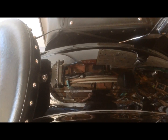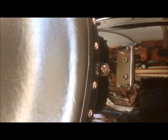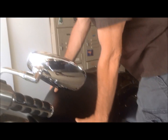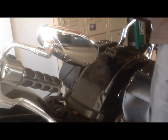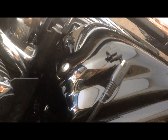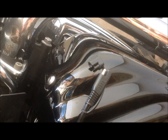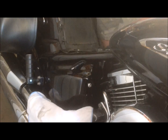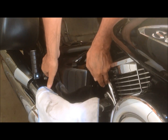The passenger seat gone, now you get access to the rider's seat, and that will require a 7mm hex wrench. Okay, to remove the rider's seat, simply pull up. We just took out the bolt and pull backwards. It's easy removal. So now's a good time to reach over and take off that right rear cover using a 7mm hex wrench. We'll be disconnecting the negative wire from the battery so we don't mess anything up while we're doing this. Okay, once you've unscrewed this bolt, you take this cover off just as if you would your tool compartment cover.